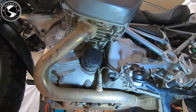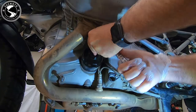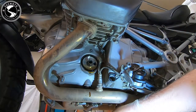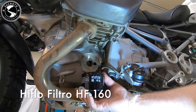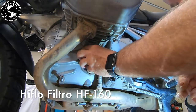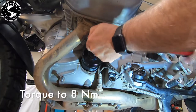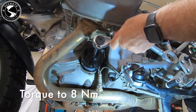I've moved the camera so that you can now see the oil filter. Using my tool, I'll take the oil filter out. I have a new High Flow Filtro HF160 filter. Put a little bit of oil around the gasket and we'll thread this back on the bike. We will torque this to eight Newton meters, which is not much more than hand tight.